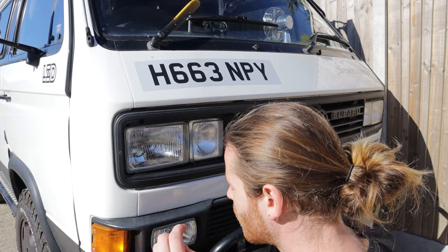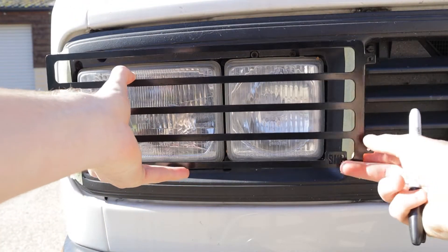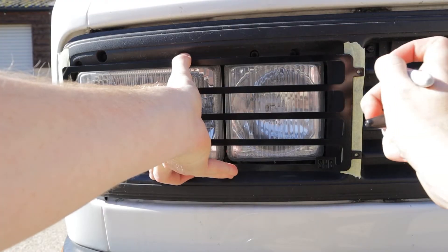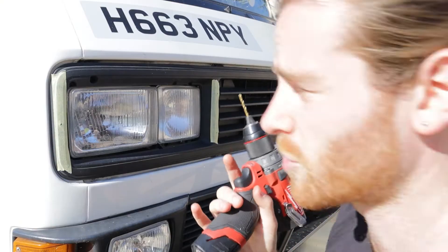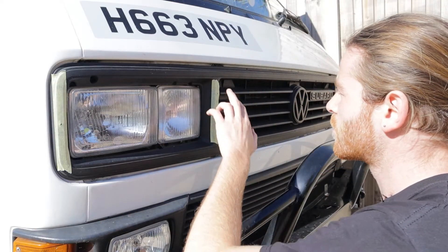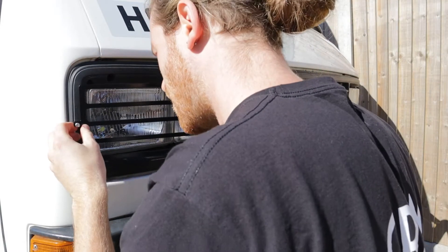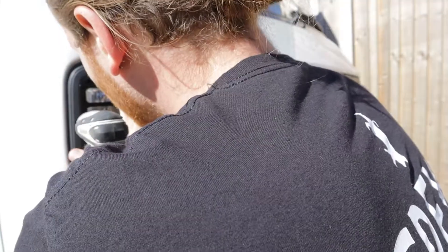Step one: mask and tape your edges. Line the tabs up with the grill, make sure everything's looking straight, and go ahead and mark the holes. We will now just go in and drill our holes. Get your spacer screw on, line her up and commit. Very nice.